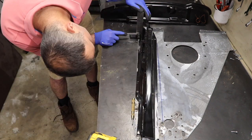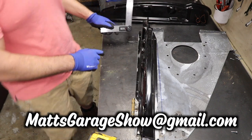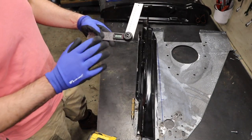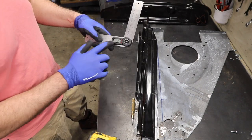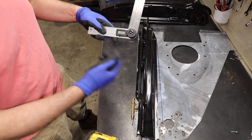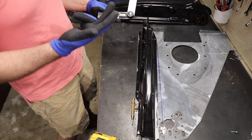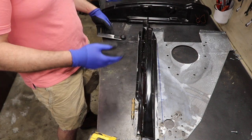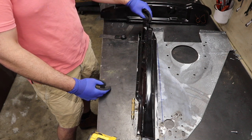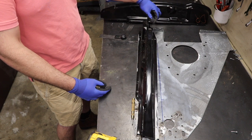I'm going to go check that on the old body right now, but it gives me some confidence because I know I need to spread this out. It needs to be closer to 94.6 and it needs to be closer to like 7.8 degrees — so 98 degrees, because I'm going more than 90. Eight degrees twice the angle. I did some calculations online because I don't remember trigonometry, but the difference between 4.5 degrees and eight degrees is between a quarter inch and half an inch or more of difference here.